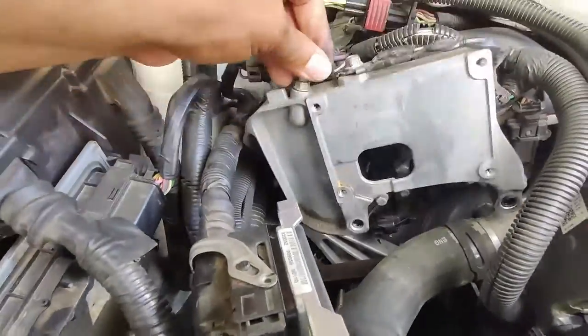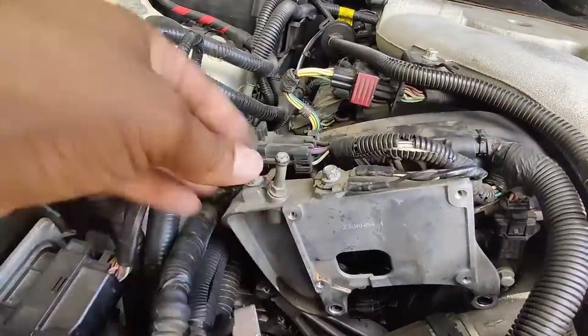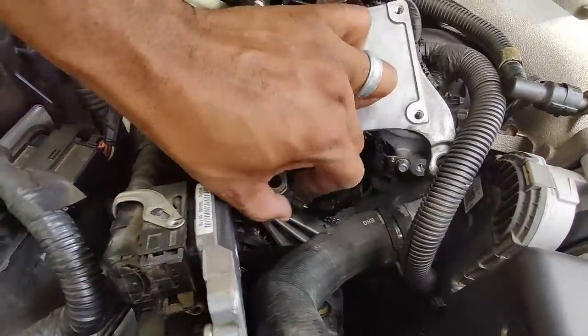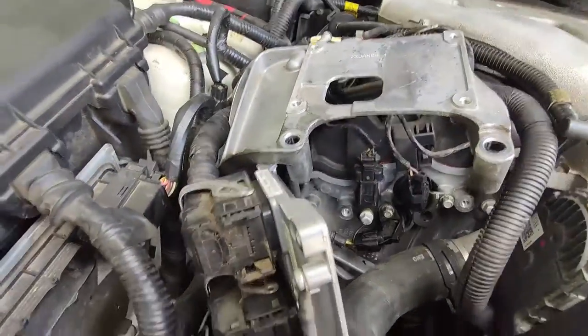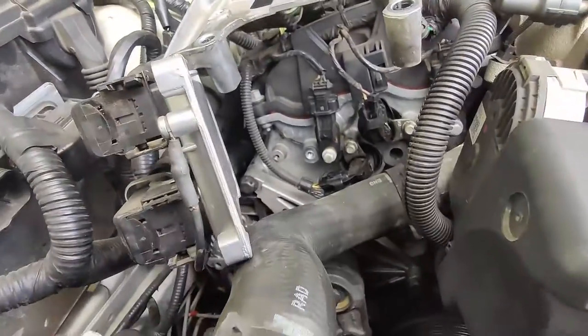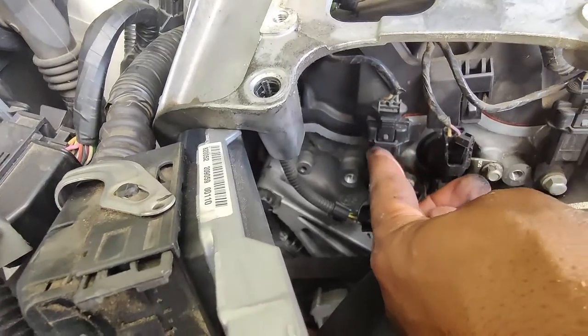That little wire up here looks like it might hold me off, so I'm gonna take a 10mm and get that off. I don't want to pry stuff too much. Let me see — flip this up. Yeah, I can get in there and work with that. Pop the hood on it down. That aluminum still got a little heat to it, baby. I'm going after this sensor right here, bank one.